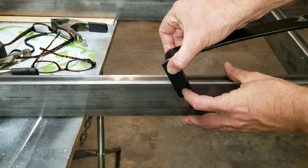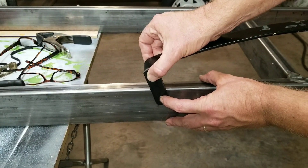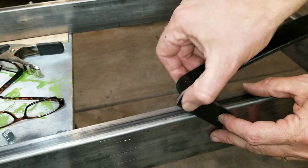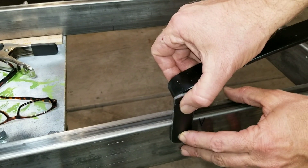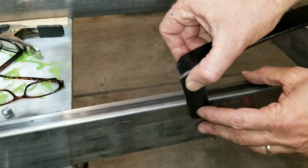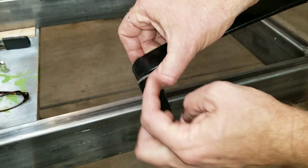When you do this you want to put this forward a little bit. If you put it straight up and down it's not gonna work. If you put it back a little bit, that's what the swing action will be when it goes up and down — it'll travel. If you put it straight up and down it's gonna be solid, it'll bind. It needs to be at a slight angle — maybe half an inch or three-quarters of an inch out of alignment from straight up and down.